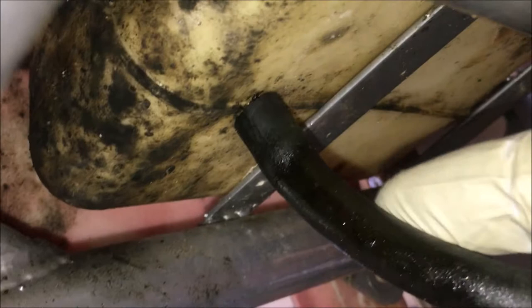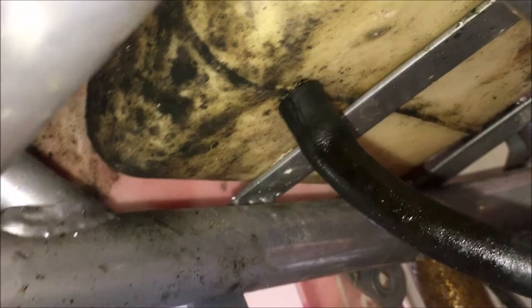All right, this is gonna be hard to show you, but what I'm gonna do is just remove this fuel line here, put a new one on of the appropriate size, and get rid of this funny business that's going on here with the two pieces that are spliced. And this one is too small for the carburetor anyway. So I'll replace it all with, I believe this is 1/4 inch, and then I'll turn you back on.